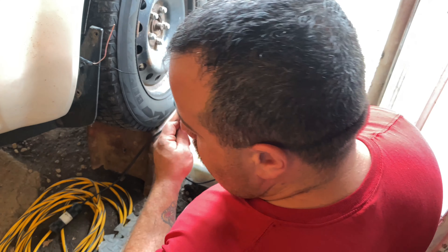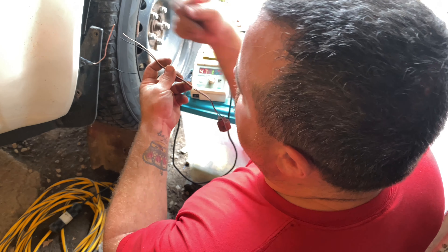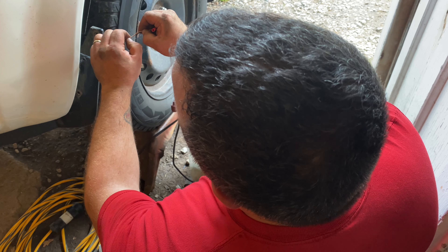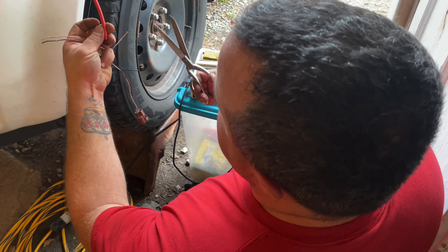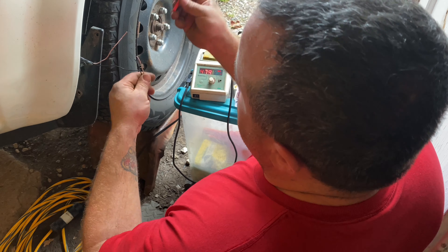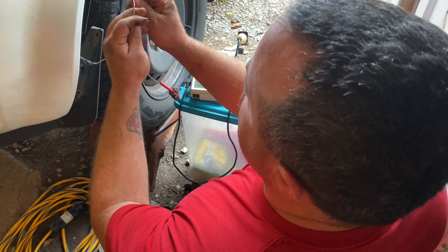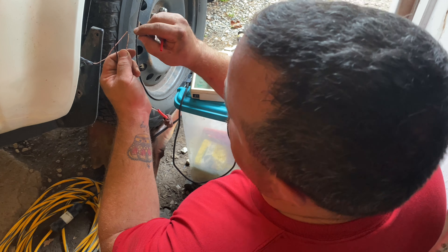You sort of have to think backwards when you want to solder and heat shrink, because your heat shrink has to be ready to go on after you solder. Once you solder this, you obviously can't put the heat shrink over the joint because it's already connected. From experience, it's going to take me maybe an inch to an inch and a half of wire space to actually make the joints. This is a larger size heat shrink — I'll cut it about in half, slide it on, and get it as far away from the joint as possible. This will be the last thing that goes over these other two joints. Then I'll take a smaller piece, because the heat shrink only shrinks so far — it has to fit around the wire pretty close, but not too snug because the joint is usually going to be a little thicker than the wire.